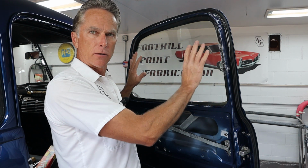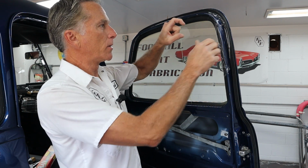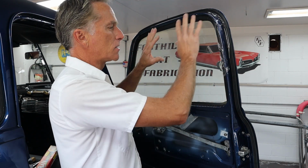We'll get the molding or the trim piece in, and then we'll get some screws in, and before we pull it tight, we'll be able to pull it away and then just pull the saran wrap out and then snug up the screws. Because if you snug up the screws, it traps it in there and it's really hard to get out, and then you have little pieces you're trying to pick out. So we just do that for a little extra protection.